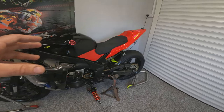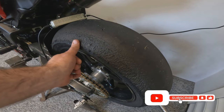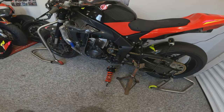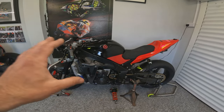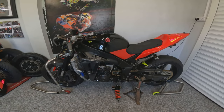On the rear, I'm not happy with the rear tyre wear — it seems a bit soft to me, potentially a bit too much rebound — so we are going to do a spring change on the rear and take some of the preload out of the spring. But before we do any of that I'm going to very quickly run over motorcycle suspension basics for anyone who doesn't know, and then we'll get into the job.